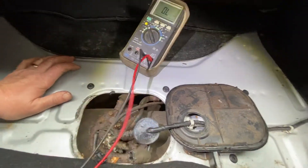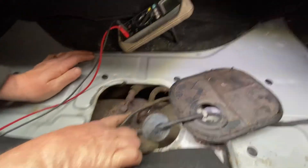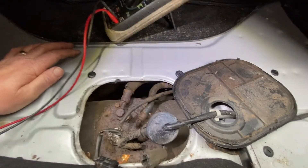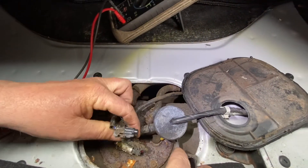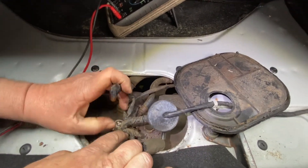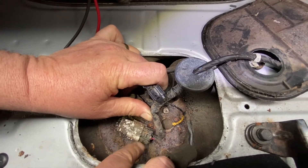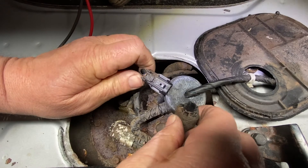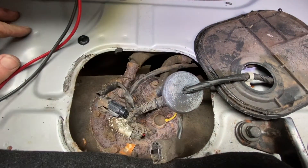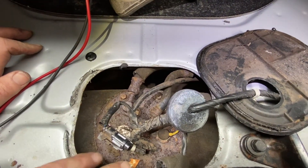To replace this pump, you're going to have screws here — 10 millimeter, these are 8 millimeter. They all look like they don't want to come out, but hopefully yours is not as rusted as this — this car's been sitting a while. You disconnect the fuel level sensor connector and the fuel pump right here, disconnect the temperature sensor like we just did, and it comes right out. You take it out, clean it up, put the new one back in, and reverse the procedure — you're done.